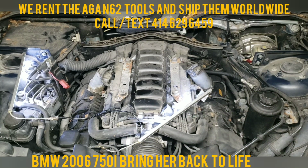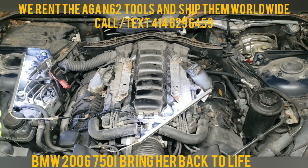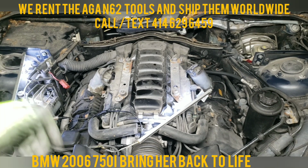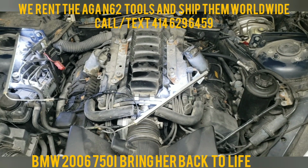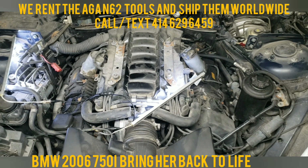You can still use the key on your key fob, but you won't be able to use the key fob alone, so everything's going to be manual. That's why I say open up your windows. Make sure your windows are open, your doors are open, it's unlocked, and unplug the battery. I'm going to unplug the battery right now. So now that we have the battery unplugged, we can move on with bigger and better things.